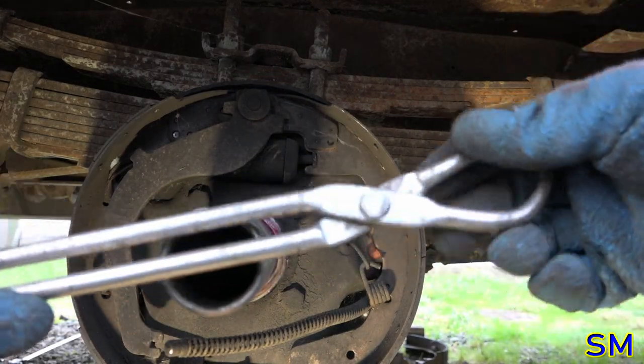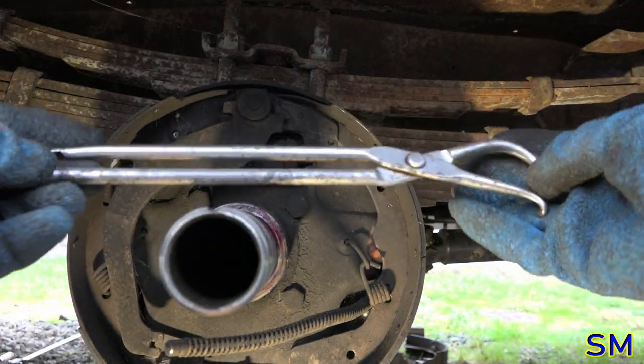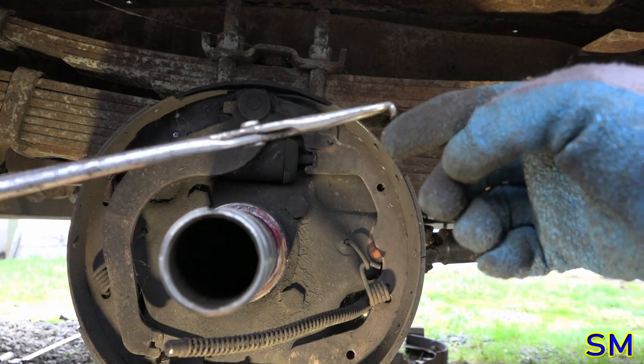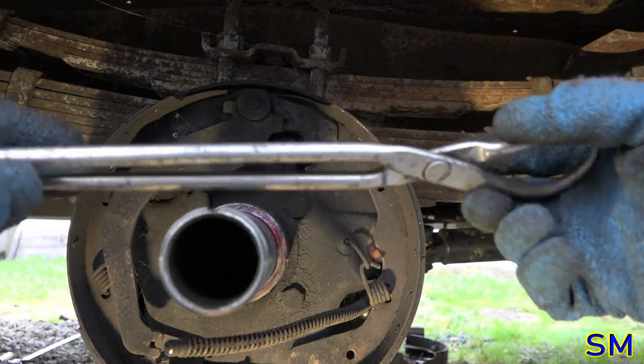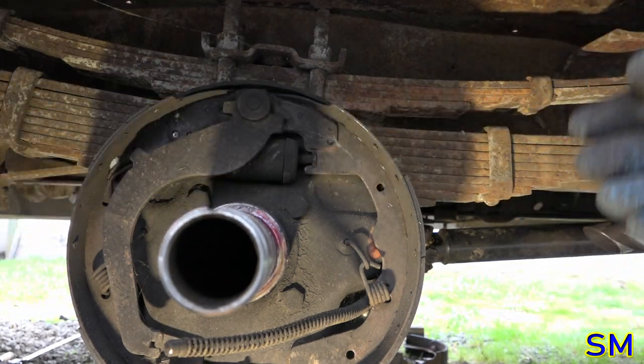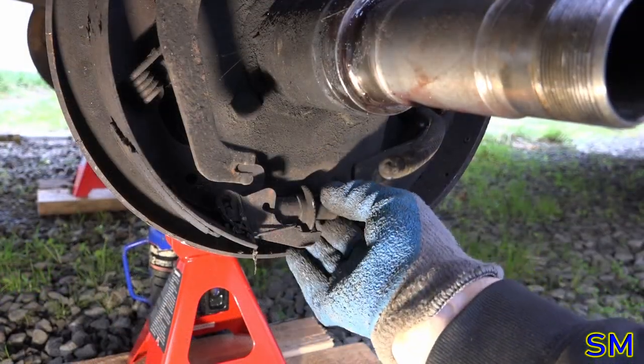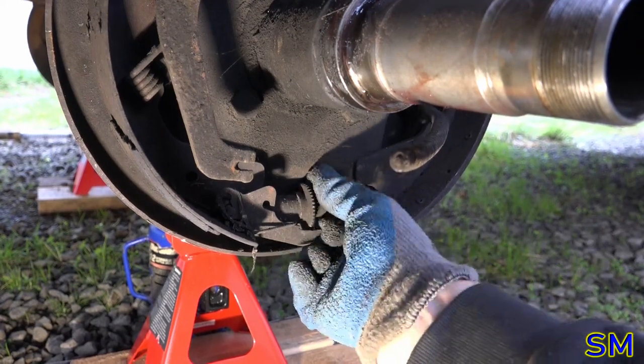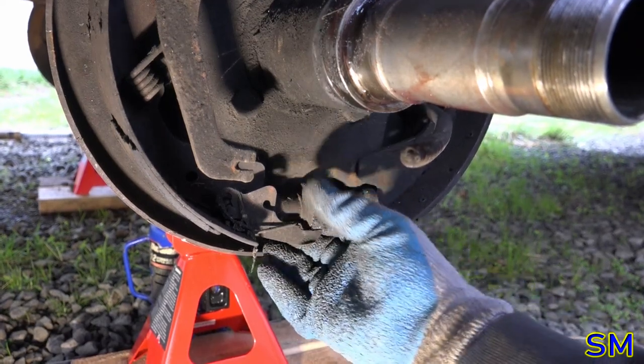Don't get the new brake pliers that are in the auto stores. Those will let you down. I've had them hook and curl right up here before. You gotta get the old American steel type. Only way to go. All right, so we're gonna, in theory, back the star gear out, our adjuster gear,